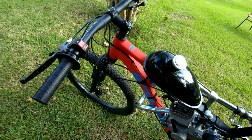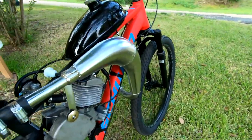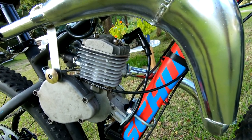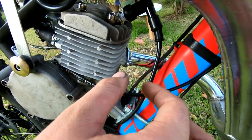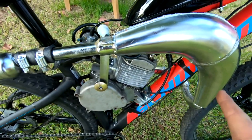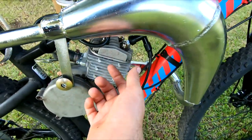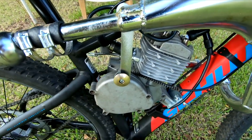The WC80 pipe — the Wildcat 80 — is fine. I don't see any issues with it. The welds are ugly but there's no pinholes. Some viewers had mentioned not to get it because they couldn't make it fit — I don't know what they're talking about. The only issues I ran into were the holes were just a little too narrow, so I took a sanding wheel and removed a little bit of material so it would mount. I've never gotten a single expansion chamber where the support tab actually lines up with the motor — every single one is always too far forward or too far back.